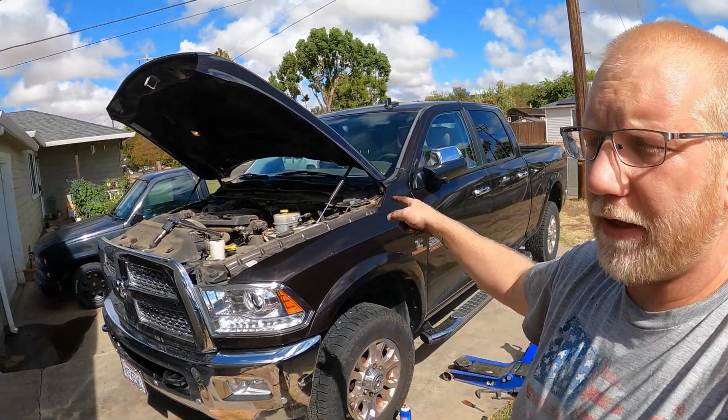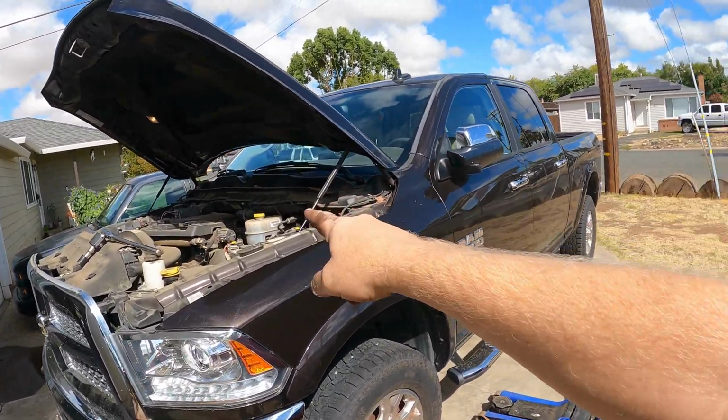Even if you're not smelling the brakes yet, don't push it. Go for a cool off lap around the block or something, and then see how they feel. If they feel like they're still a little spongy or not quite grabbing like they were, try it again. And that's how you change the brakes on that guy. Don't forget to close the lid on your reservoir, and you're done.